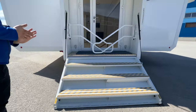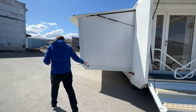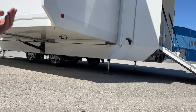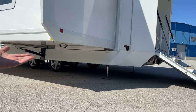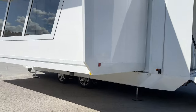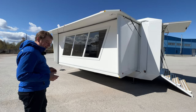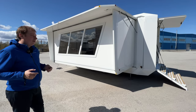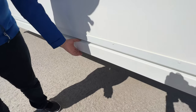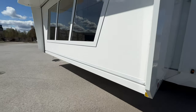Also there's a side skirt. The idea is that if you look below the trailer, the side skirt prevents dust from getting onto your internal walls while driving in bad road conditions — it catches the dirt and doesn't allow it to reach the roof panel, keeping it clean when you open it. The trailer is really well insulated — it has at least five centimeters of XPS foam insulation all around. Most producers don't insulate the floor, but here you can see the floor panel thickness; it has an aluminium frame inside and everything is insulated.